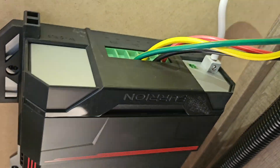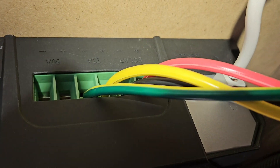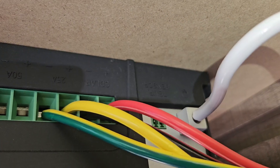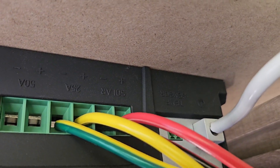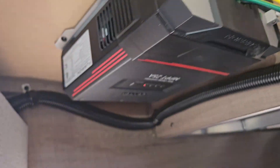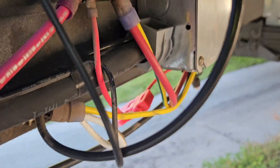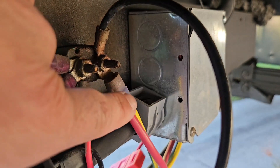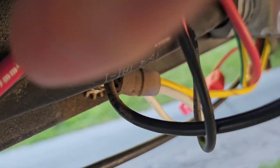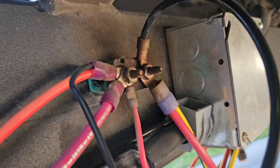That seems to be what's going on here. Going into the negative port is the yellow and green wire, and the positive port is the yellow wire — so yellow and green going negative, yellow positive. Now if we come around the outside on the frame, we've got the opposite: the yellow and green wire down here is connected with the positive, and the yellow is grounded to the frame as the negative wire. So it's exactly reversed from what it should be.